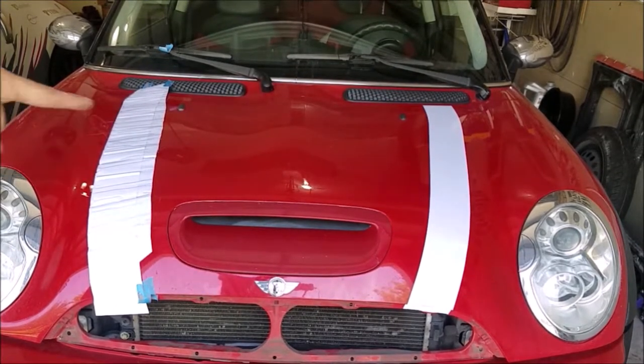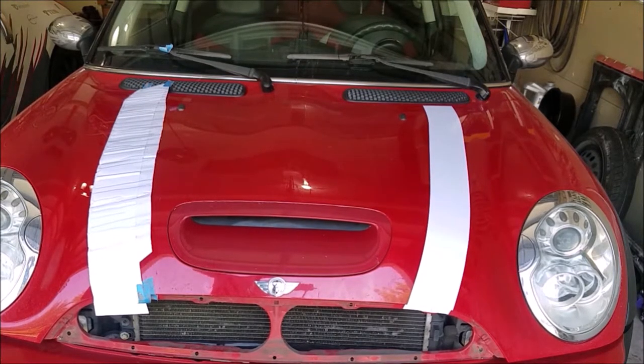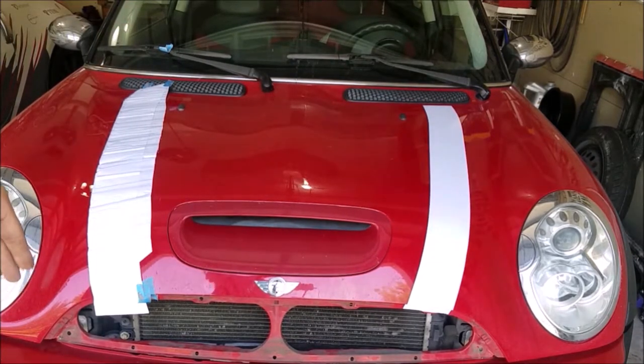I'll spray down the bottom half of the hood and start the stripe there, working my way back so the whole bottom half is stuck down, then spray the top half with soapy water and peel and do the back half. Use more soapy water than you think you need — you can always squeegee it out. I'm using a squeegee with felt on the leading edge so it doesn't scratch the vinyl. Squeegee a little, then wipe with a paper towel or microfiber to absorb the water — keep working until there's no water underneath and it sticks. The soapy water lets you maneuver the stripe so you're not stuck with your first placement. I did the entire driver's side without any heat gun or hair dryer and it turned out great.